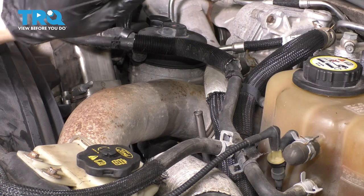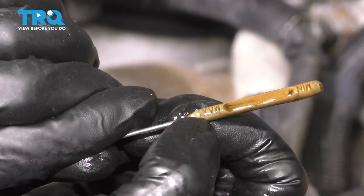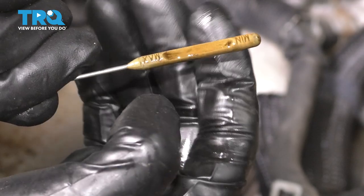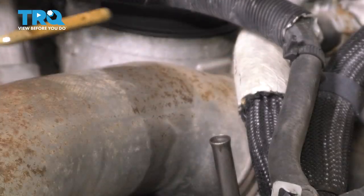Don't wipe it this time because obviously we want to see what it picked up. Looking at the dipstick right here, you can see the level stops right after the max line. It might be hard to see on camera, but you can see how the light is shining and reflecting off the oil. It stops right here — so we're good to go.